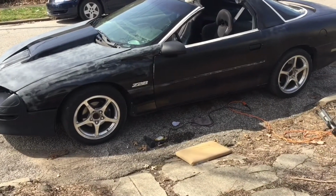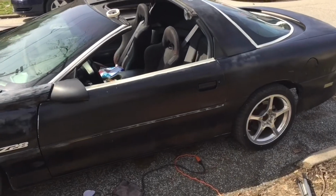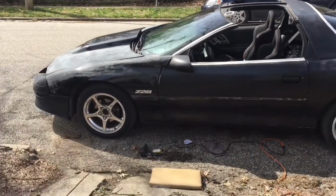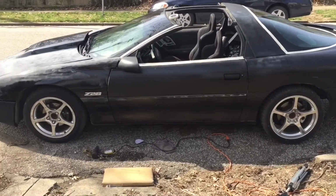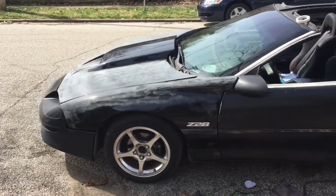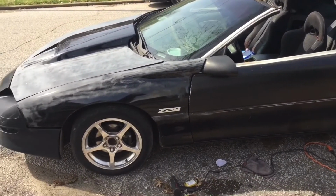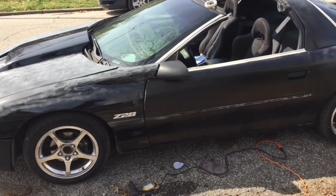I was gonna do gold flake, but I think for now I'm gonna add the gold flake in later. Since you put the gold flake in the clear coat, I'll just do a couple layers of clear right now, and then in the future if I want to add it on, I'll just sand down the one layer of clear coat and throw on some gold flake with the clear coat. All right, I'm gonna get back to masking off, and then we'll get to painting.